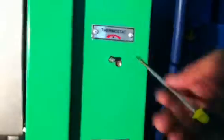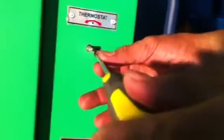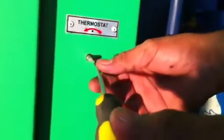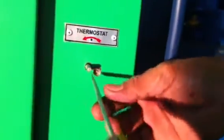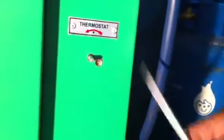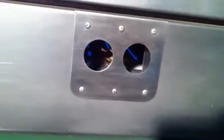We need to lower the automatic stage. Pull out the thermostat knob again, and this time using the flat screwdriver, move it clockwise — going to the right — so that the flame becomes smaller. Those are the basic things we need to do. You can see the automatic stage flame is now smaller.